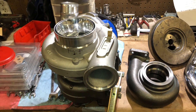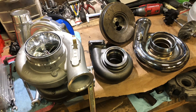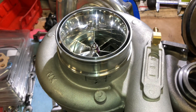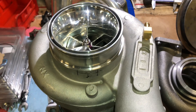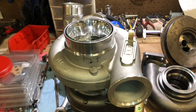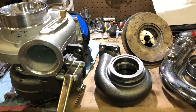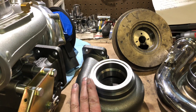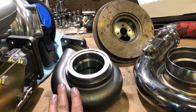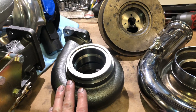Here's a turbo that's bigger on the compressor than the one I showed you. You can get a size comparison — it's much smaller in frame. This one has a 67 millimeter compressor wheel, but there are options for 60 and 62, all three of which are rated over 700 horsepower on a gas engine. For diesel, go with the 67. The turbine options are 64, 60, or 67 millimeter. I prefer this turbine housing I designed — a T3.82 — it's much smaller but can be machined for a bigger turbine to pick up spool.